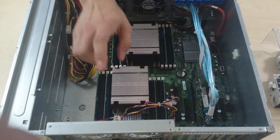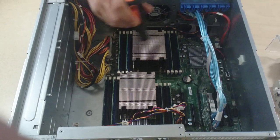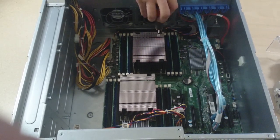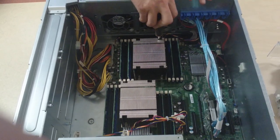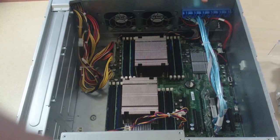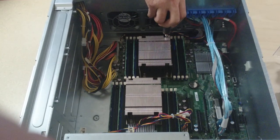So there is CPU2 and CPU1. Now, how to remove those heat sinks — first of all, we're going to go in a diagonal cross pattern. Make sure you don't exert too much stress on the screws; otherwise the edges will be gone and it's going to be harder for you to screw the new heat sinks in, or you may even damage the socket screws inside. So we're going to loosen the first screw. When you hear a click, you know the screw is loose.